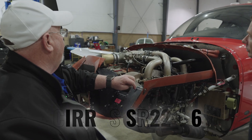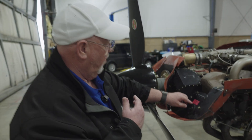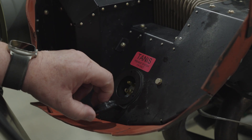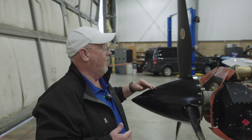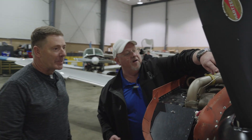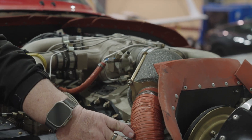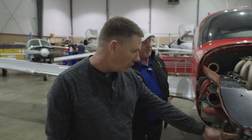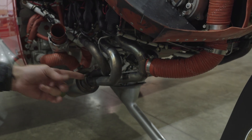It comes right up to the scat tube and right on into the manifold system going down into the engine. A lot of people don't understand alternate air. My understanding, Tim, is it comes right in the air filter right here, and that this hose has nothing to do with it unless we're taking alternate air. So that scat tube here is for alternate air use only, and we draw the alternate air source from the tailpipe. So it's a heated source of air selected by the pilot.